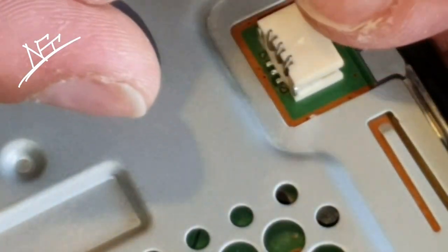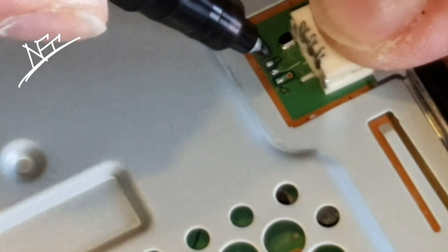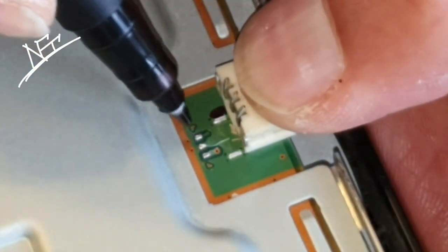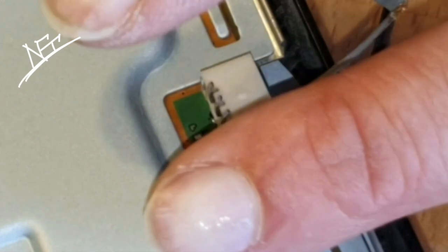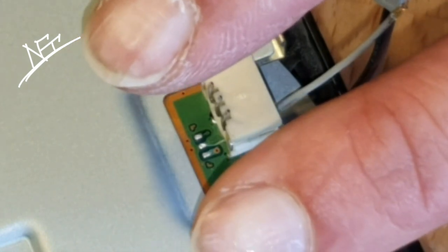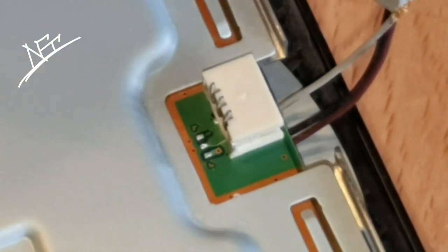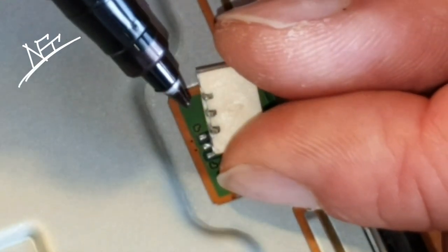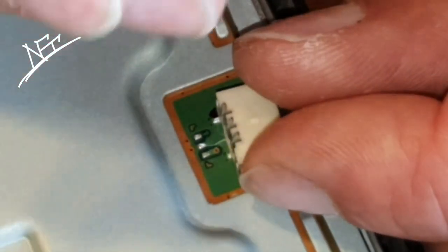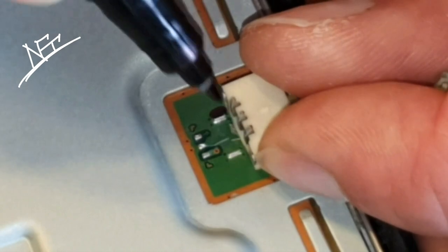You need to take care, because you also need later to bend this contact, because here inside you can see these three contacts — they are very near together. On the PlayStation 3 the space is about this much, but on the PlayStation 4 the space between the contacts is really just very tight. So you will need to bend these three pins on the adapter near together. And you need to take care that you do not solder these three contacts together — you do not want a short circuit.